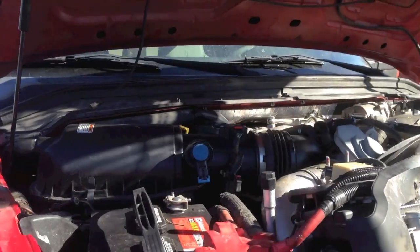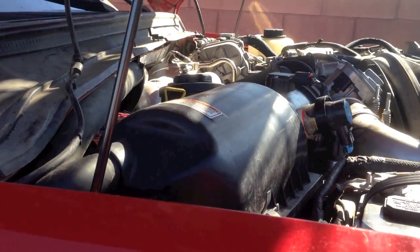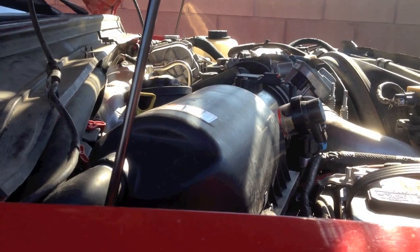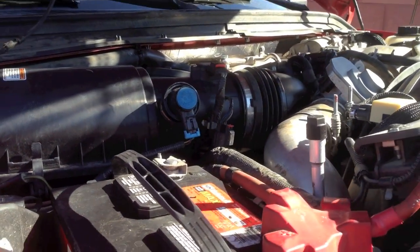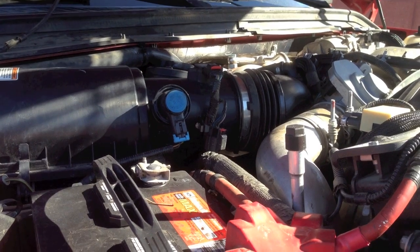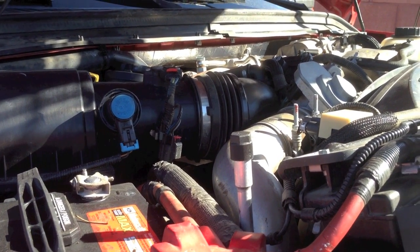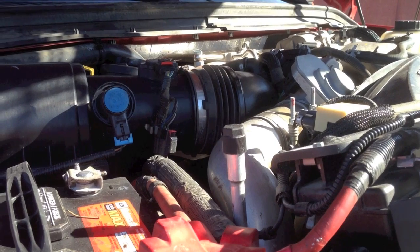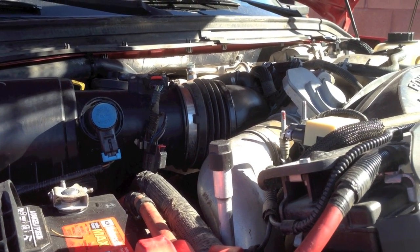There we go with the new rocker arms on. You can tell no more popping through the intake. Noise is all gone. Keep up on the oil changes. This isn't real common. We get a couple, 3 a year, so we see it, and every one that we get also has the oil overfilled.